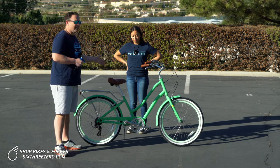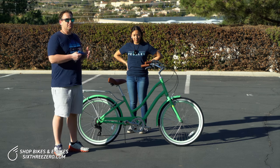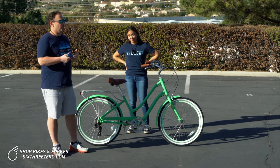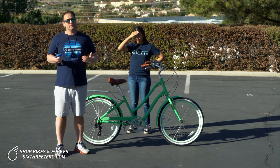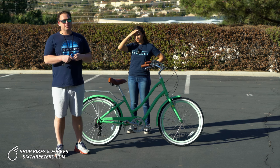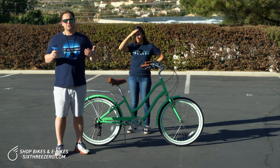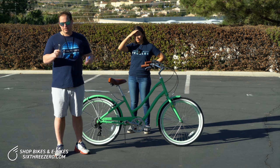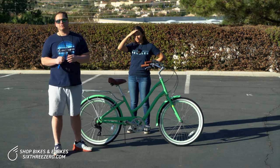Alana is 5'1". We'll just move through the adjustments until we finally get the bike in the perfect position for her. In this case, we're going to adjust for overall comfort — what feels good for her. And in some cases, it really is trial and error. The beauty of it is, with how simple it is to adjust, you can ride the bike a few miles, come back home, and make adjustments until you dial it in. You only need two tools — a 14mm, which adjusts the tilt of the seat.